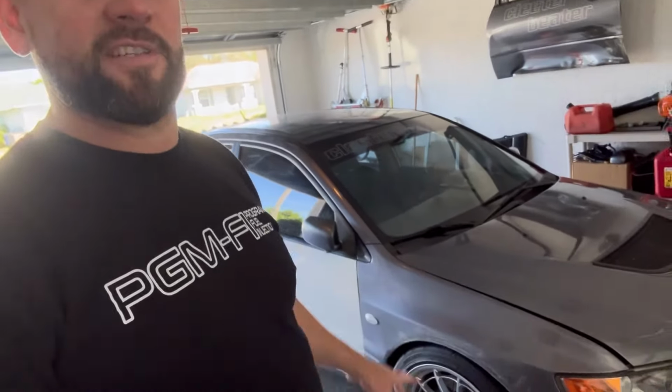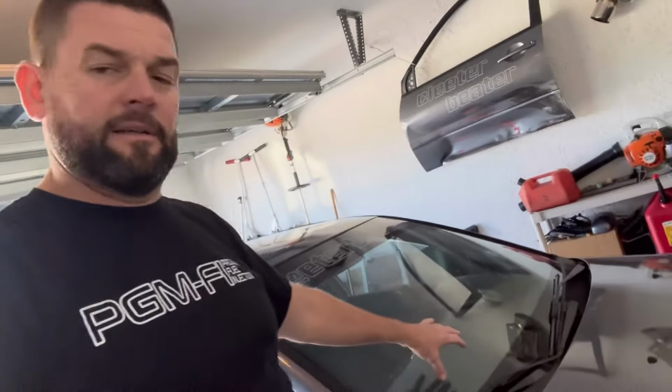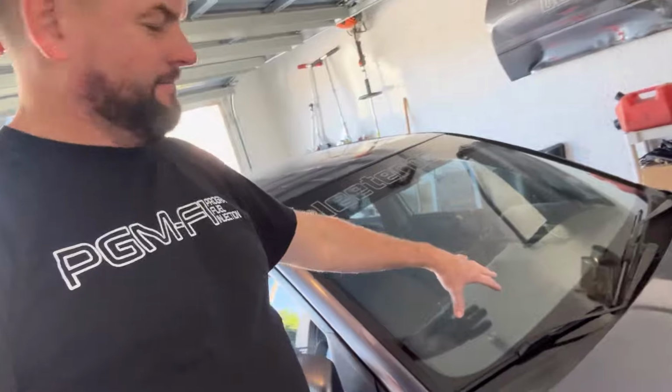One being the passenger side airbag, okay? Only 8 pounds, so, you know, a lot of people out there be like, oh, run a gallon less of fuel. Sure, about the same weight. Thing is, passenger airbag, it's over the front right wheel, essentially. It's within a foot of the front right wheel, which is where you want to eliminate weight when you're going around a circle track, is the front right.